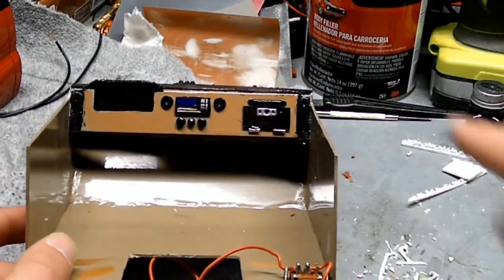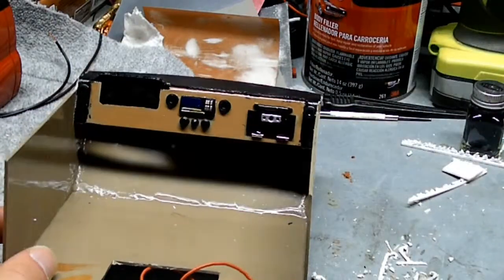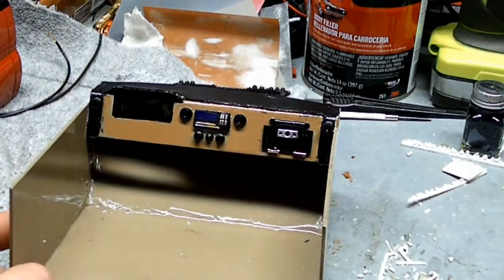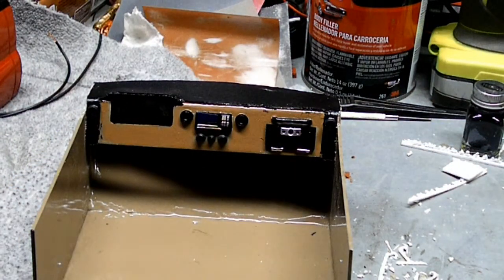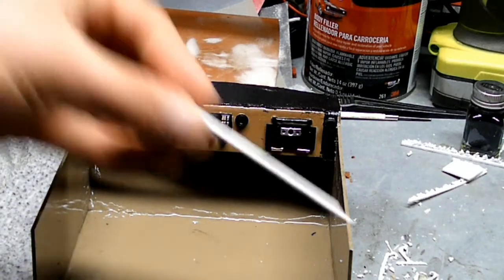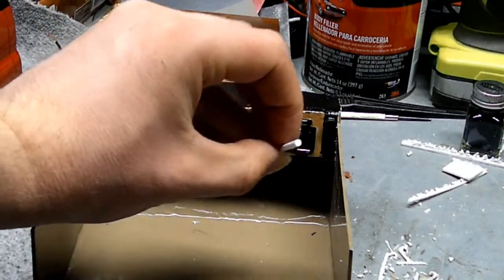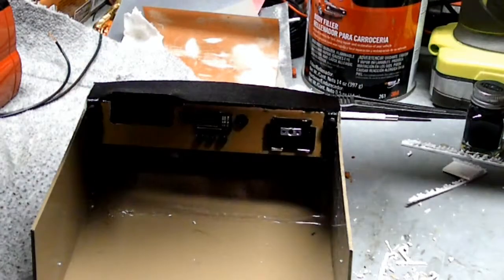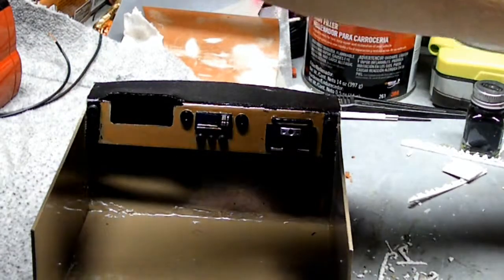And then over on the right, this would be the glove box. And there's also an oh shit grab bar right there that the passenger would grab onto if there's an oh shit moment. I guess we'll start with the oh shit bar. That is actually a piece of polycarbonate dowel, or rod, I guess you'd call it. All I did is heat it up, and then I bent it around on my bender that I had made years ago now.